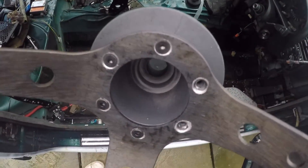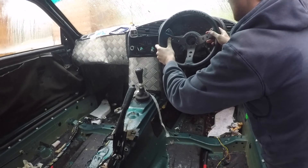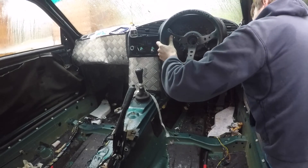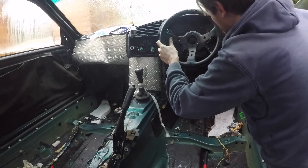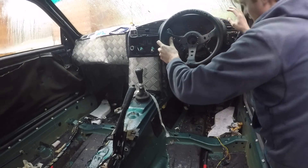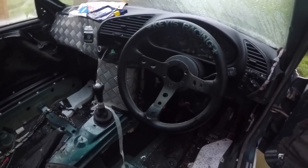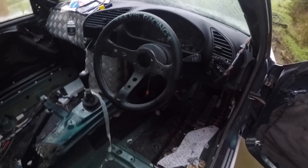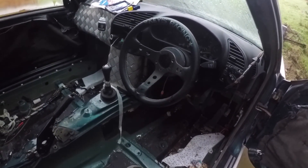The boss kit I got didn't actually come with a top dead centre dot that they usually do, so I put the steering wheel onto the boss, and then I'm going to mount it onto the actual steering column, just so I can get a good idea if it's centred. This is just the steering wheel hooked up directly onto the boss. The quick release isn't on yet, but that'll come later.